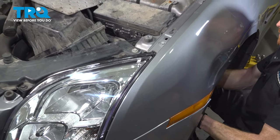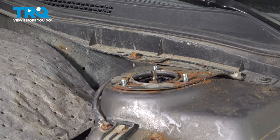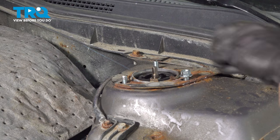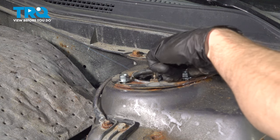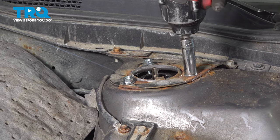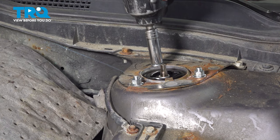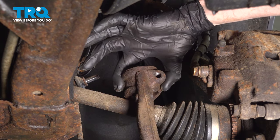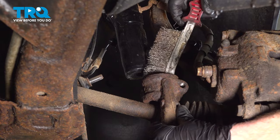At this point let's remove the strut from the machine and make our way back over to the vehicle. Let's get this in the vehicle — get this aligned along the top here and start on all three of your mounting nuts. While we're up there let's bottom these out. Once we bottom them out we'll make our way back into the wheel well and torque these once the wheel is back on the ground. Now inside of the wheel well, make sure you clean out the port where the strut will go into — use some sandpaper or maybe even a wire brush, give it a quick cleaning, and then we'll continue on with some anti-seize.